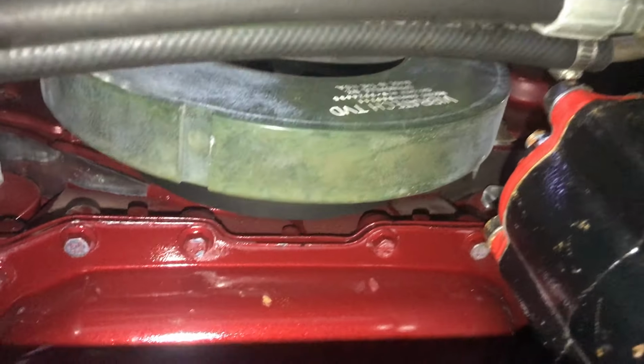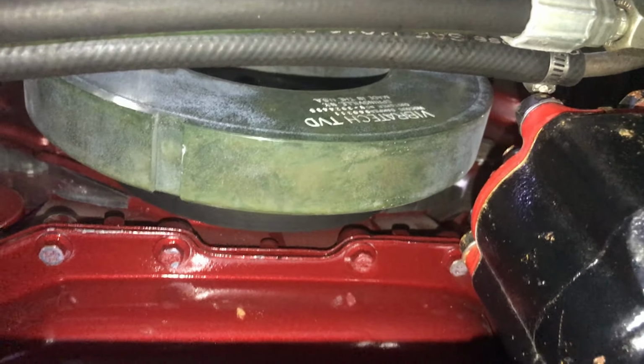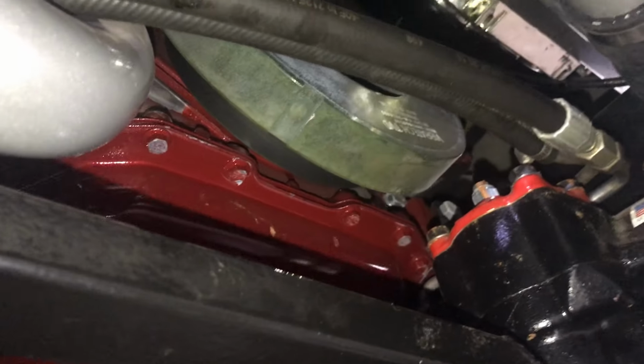So if you look from down at the bottom, you do see 2 harmonic balancers from Fluidampr. They were a sponsor. That does make a difference on these 2 engines. There's a lot of rattling on a Cummins to begin with, but with 2 of them, it's really bad.